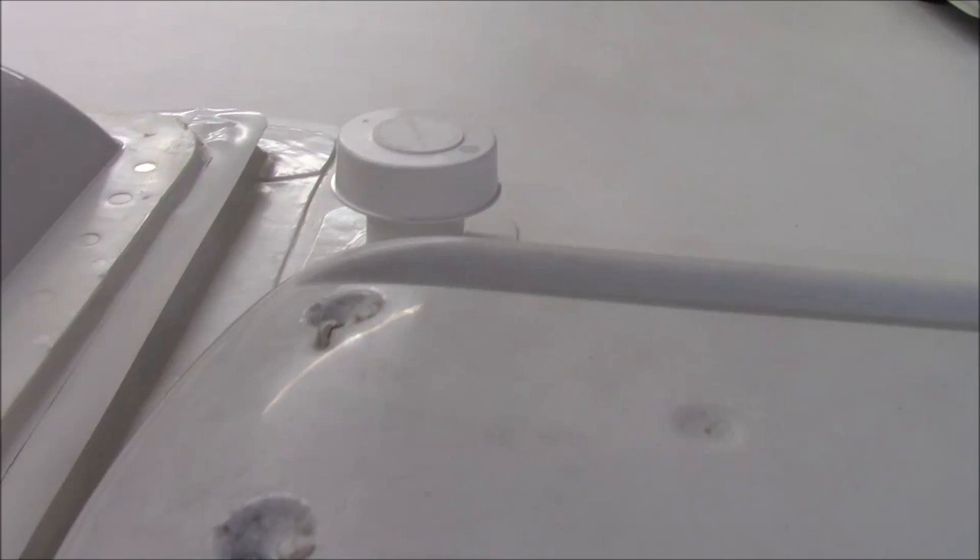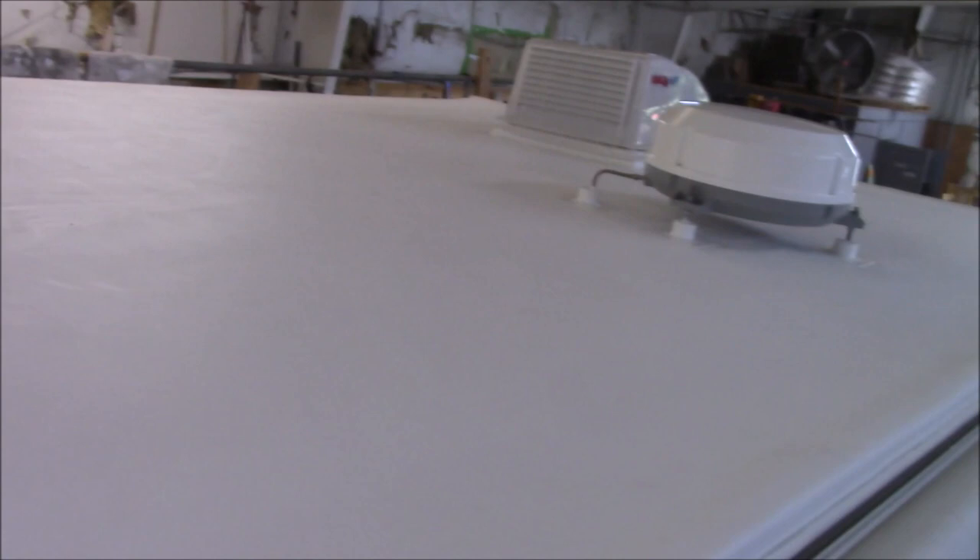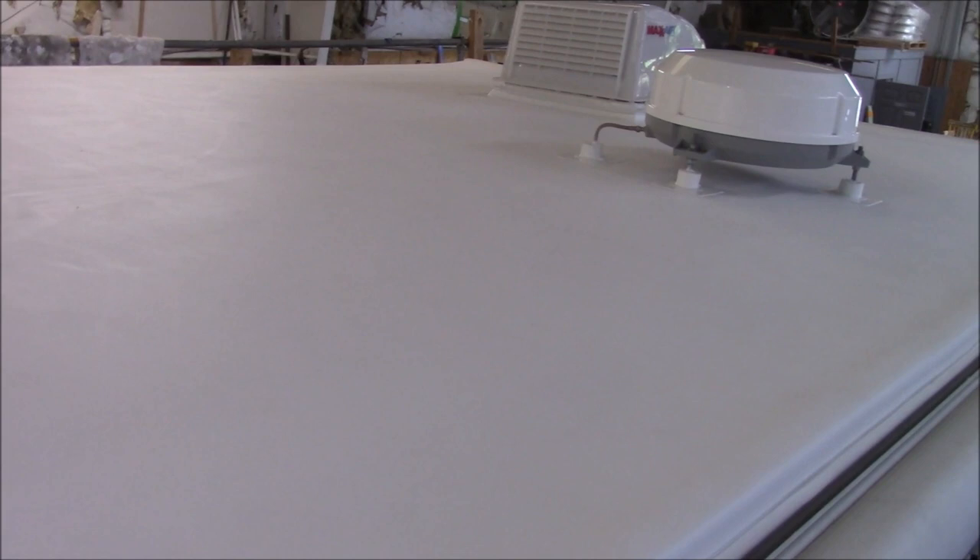Everything is heat welded right here. This is the counter flash — we put this counter flash on so if you get caught in a heavy rainstorm, when it comes up on the curb it'll get redirected around, minimizing what's known as an erosion effect. That's why everything is elevated off the roof line on a commercial project — because it works. These big buildings would be saving a lot of money if they could just squash everything down like they normally do in RV manufacturing, just run some screws in it and slather it with self-leveling. But it just doesn't work.